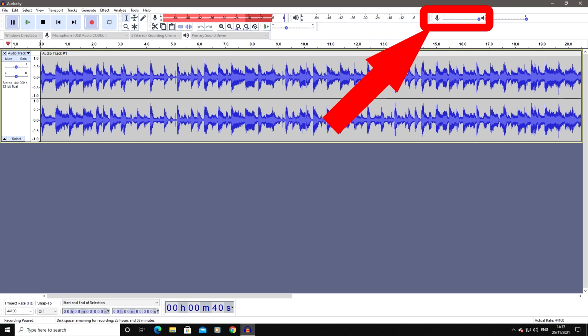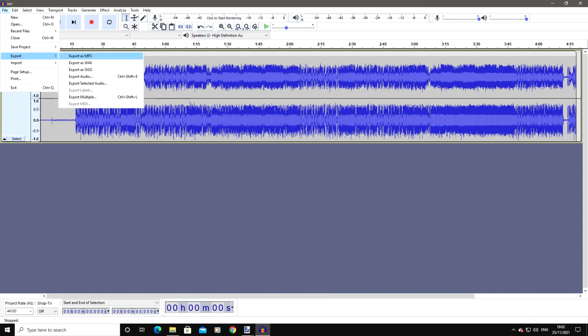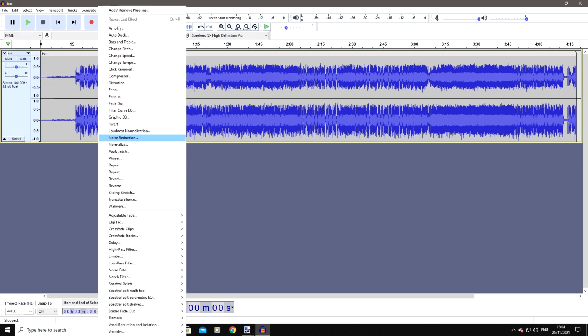And the volume control, or the recording level, will be that top right hand adjustment in Audacity to get the correct recording level, unless your tape deck's got an actual variable output, which only the towards the top end ones do. So on the main case, you'll be using that input level, that recording level, to adjust the input level to get it to the right volume you want, so it doesn't distort and does a good recording.